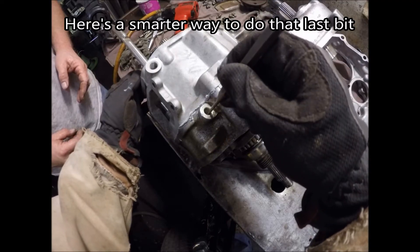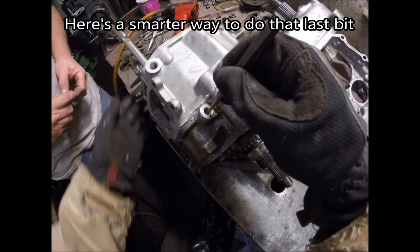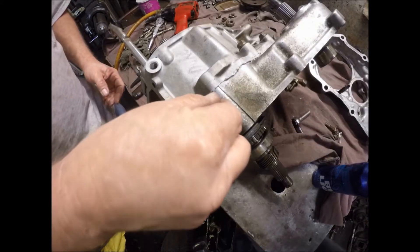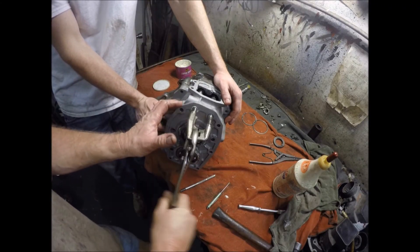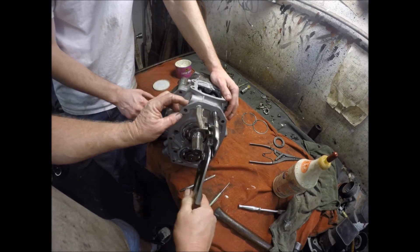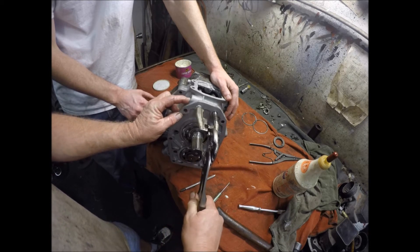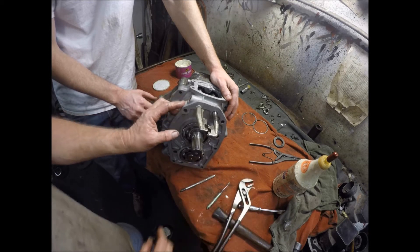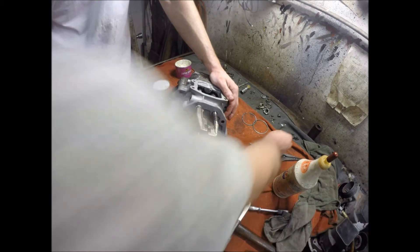See, this can slide. Put this tiny punch in there to figure out where it needs to sit and put the pedal in. That's the thing for the four-wheel drive indicator light — because there's a four-wheel drive indicator switch there. If it has a notch, it works the same way as a backup light. I completely forgot we have one of those. You want to install a roll pin?